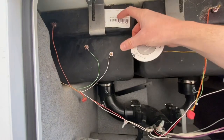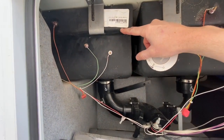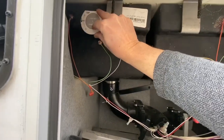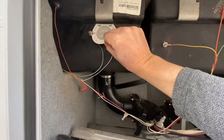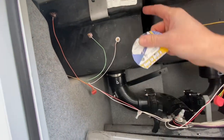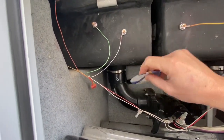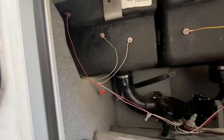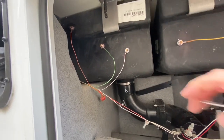They say to do it two inches down from the top of the tank. This lip here is almost two and three-fourths inches, so I'd either have to go almost to the very top of the tank or almost about three inches down. The good thing is the sensors are on this side. The toilet is actually on the other side of the tank, so it is far away from where waste is coming into the tank. With the sensors being right here and this thing whipping around right here, it's going to keep these sensors cleaned off. That's kind of the main concern with installing a black tank flusher — just to keep the sensors clean.